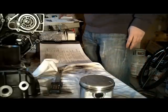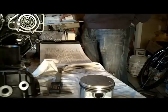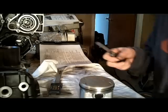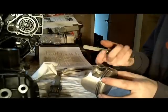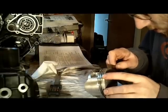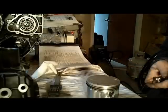The next test for these piston rings is to check their groove clearance. The top one should be between 0.03 and 0.07 millimeters, and the second one between 0.02 and 0.06 millimeters. The service limit for the top is 0.17 and for the bottom 0.16. So even though the rings measured a little thin, as long as groove clearance is okay, I think I'll be alright. I don't have a 0.07 gauge so I'll use 0.06 to check the top one — it doesn't quite fit, so that looks good. Using the same gauge on the bottom — it doesn't get in at all. My groove clearances are okay.